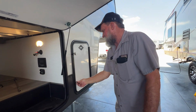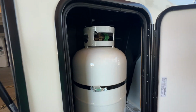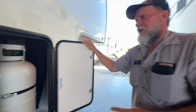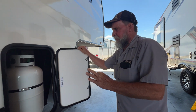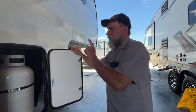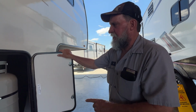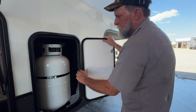We're going to come right past that, come up to the front propane bottle on the door side. It still gets switched from the auto regulator on the off door side, but it has its own little red regulator over here for the pressure. If you have both bottles open, even though the one over there is the one you got it turned to, and it would happen to run out of propane, it'll automatically pick up from this one here, so you don't lose your gas service in the middle of the night.